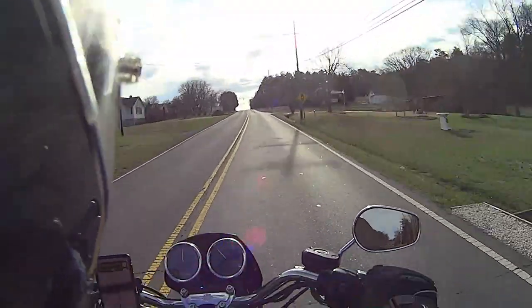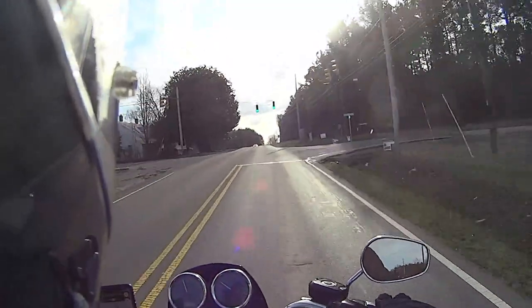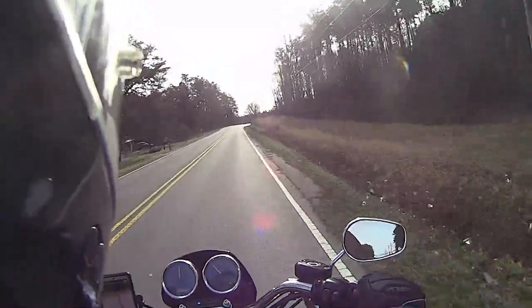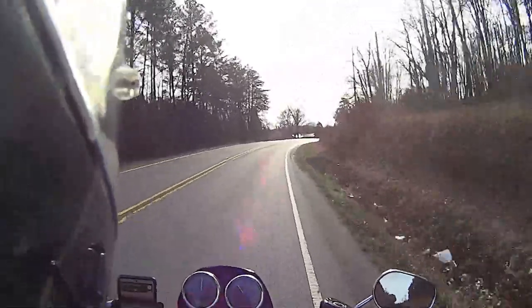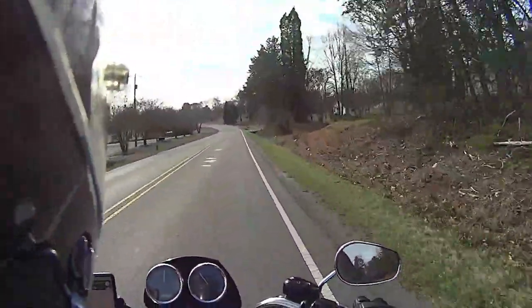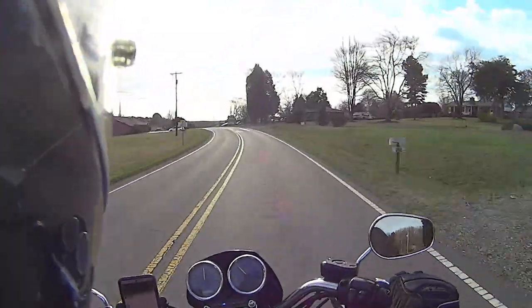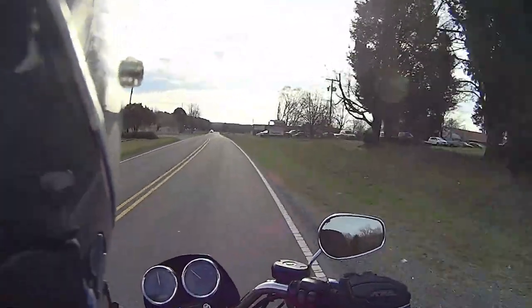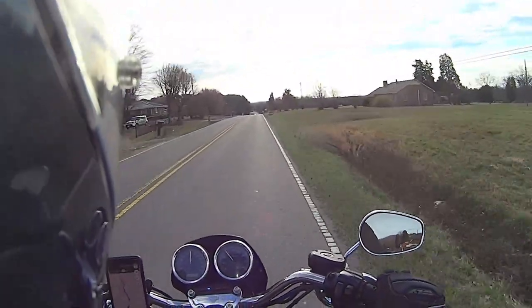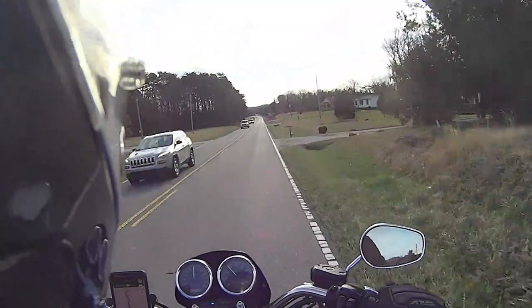I've already put 70 to 80 miles on this, so I'm not totally talking out of nothing. I can only rev it to 4,000 RPM and can't go full throttle — keep that in mind. That said, I did the Impact 560 cams, which give you a redline out to 7,000 RPM — the cam actually makes power higher than that but they said cut it off at 7K. I also got the 1275 kit with a valve job and mild head work. The 2004 to 2006 Sportster heads are the best-flowing Harley Sportster heads ever made per Hammer, so I left them mostly stock.